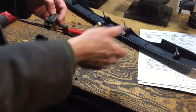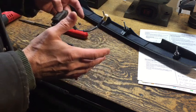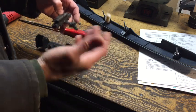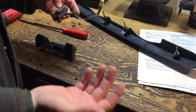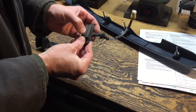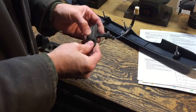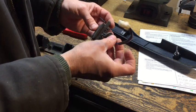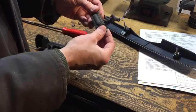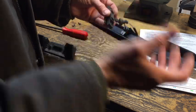Obviously you can't really tell on camera because the switch itself actually looks fine, and there's no point in doing a continuity check to show you. It did work from time to time but got progressively worse and worse to the point where it may open one out of ten times - and who wants that? You want your trunk to open every time. The switch itself feels stiff and just doesn't feel right - like it's not actuating properly inside the switch assembly. I've popped the plastic frame and the micro switch out before, but I have no intention of doing that again. Just fix it right.